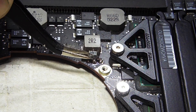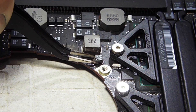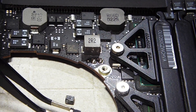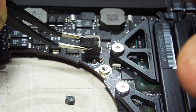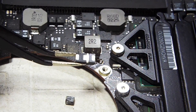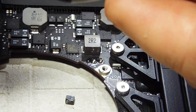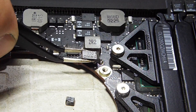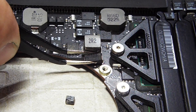We got the chip off — it took a little more time than hoped with the hot air. You can see the back of it has two connectors and a little plus sign for positive, and that was towards the heat sink, so take note of that. We bought a new chip — it's a little bigger. It has a bar on it; that's the positive side on this chip. On the back it has three connections; you'll be using the end one and the next one over as what's important to hook onto your plate. I've tinned the plates with some electronic solder, and now we'll attempt to solder it back in place.